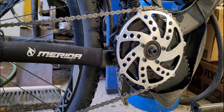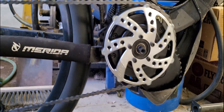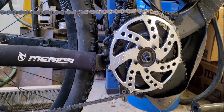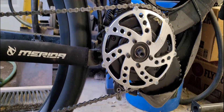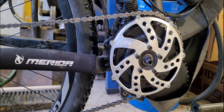I'm going to do a spin just to quickly test it. Right now it's on the biggest gear and it's not pulling off. It sounded a little bit clicky — and I can see it still needs to go more to be perfectly straight. But this is on the biggest — it should be straight when it's in the middle. I'll drop it down a couple gears. Okay, now we're in the middle and it actually looks pretty straight. It could still probably go another half inch, so it's going to line up with the 11 tooth better than it lined up with the 36.